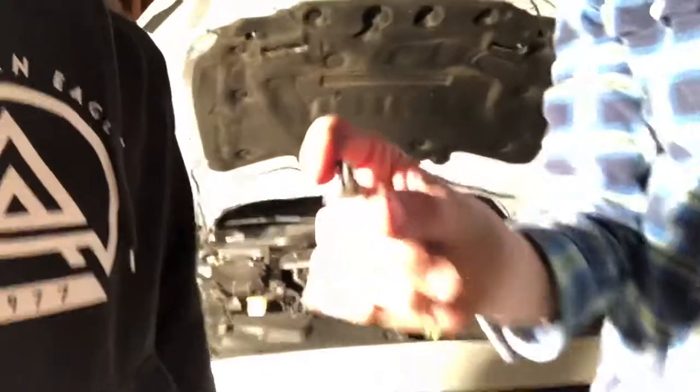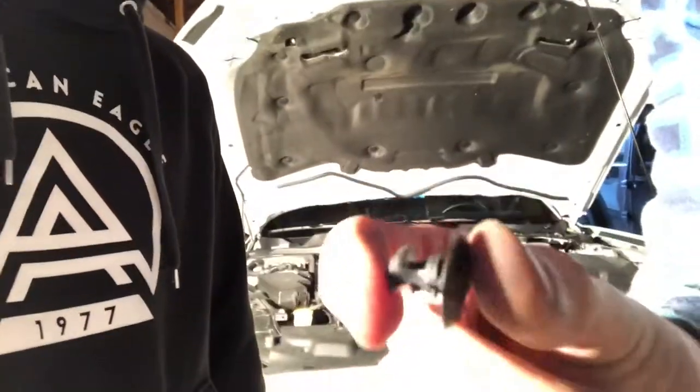It's got little dowel pins right here, like you'd have on a transmission, that hold it. Lift it up, pop it out, unplug the harness from the bottom lights. She pops off. The grill has clips in it. Easy, somewhat. Easy, little squeeze. And that's really about it. So, I think it looks good. Whoever designed these things, those clips are awful. But I was telling him they have a really nice tool that slides underneath it, like a plier. They're very nice. That's about it, guys.